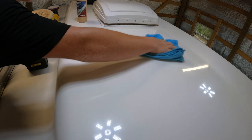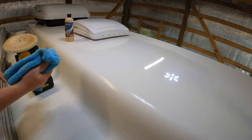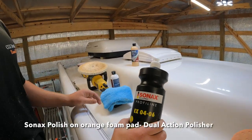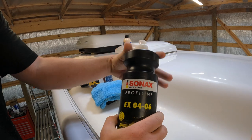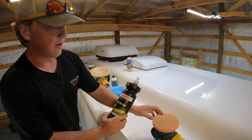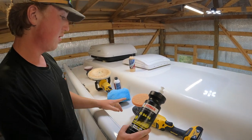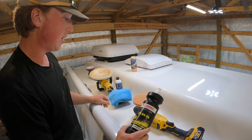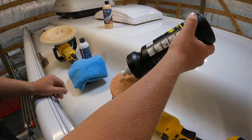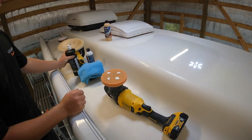There's still a slight bit of dullness and a few small scratches and swirls left. To take care of that, we're going to use Sonax EXO 406 — it's a really light polish that takes out all those fine imperfections. We use that on a fine foam pad, these orange pads, along with a DA dual-action polisher. We use about four small dots — it spreads out really well.